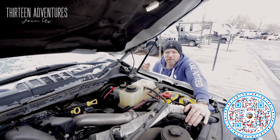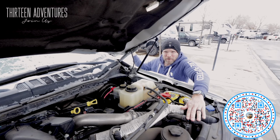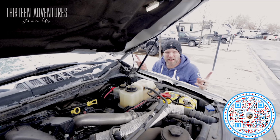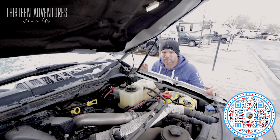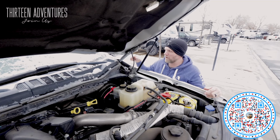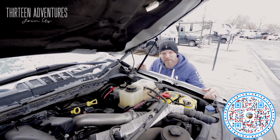On the rear, a couple of you asked questions. The negative side of the plug back there and my hitch, it's a very short wire. It's probably 2.5 feet, maybe 2 feet, and it runs right inside the bumper, and I drilled it right inside of the frame with a self-tapping screw, and I just grounded it right there. So that's where the ground is on the truck. I didn't want to run a ground wire all the way back. There's no need for all that. So I'll show you those things.